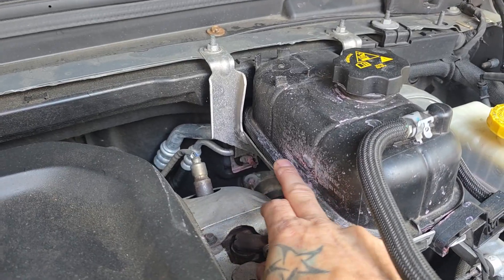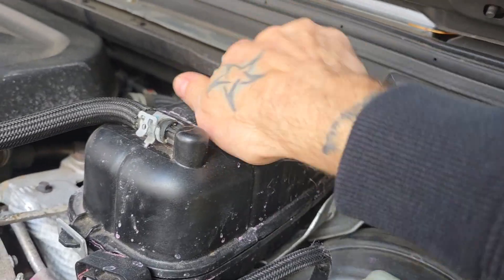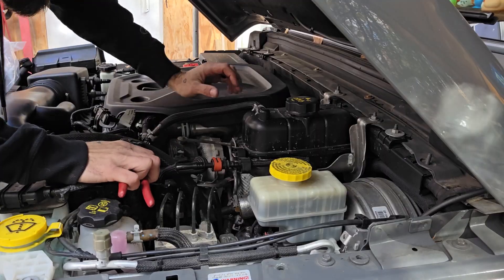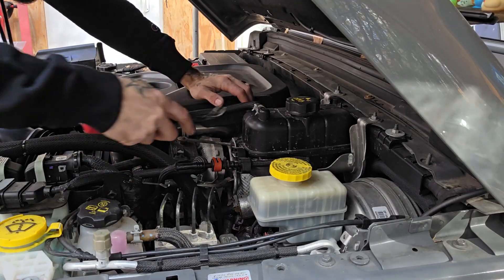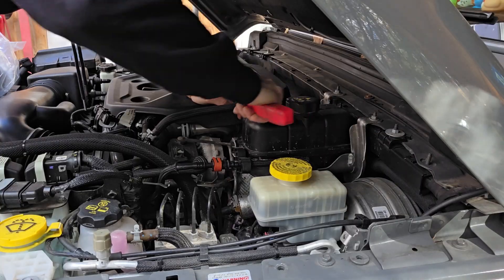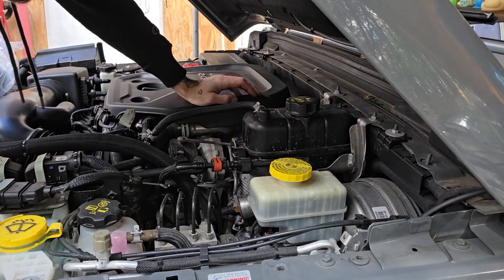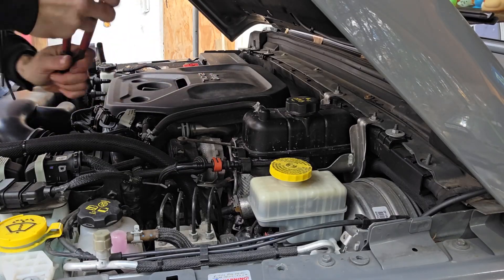This pink stuff is your coolant — that's the telltale — with the other telltale being that the bottle is going to be completely empty when you finally do get into it. Now while it's absolutely terrible that Chrysler saddled this otherwise very good engine with this terrible cooling issue — probably two engineers not talking to each other — it's mercifully easy to repair. You can do the whole thing with a 10-millimeter and some tools you have sitting in your garage.